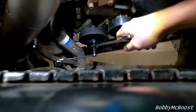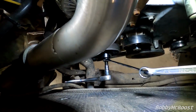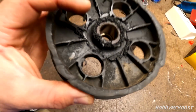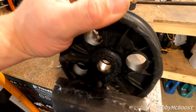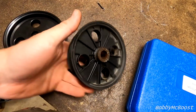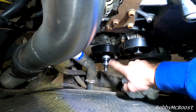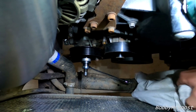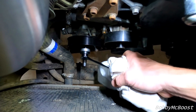Huh? It got tighter. It's gotten easier. Here's the pulley, and that's what's happened to the back of it. Took me a while to figure this one out, but with all that out of it, it makes this real flexy. Bit hard to show, but yeah, that crap. There's the fresh one. This one's had a hard life. It's pretty tight, and I couldn't hold the socket on this end while doing it up because it would just undo itself, because it spins the other way, so I got a big Allen bolt thing holding it, which is probably definitely recommended by Ford. Let's put it that way.